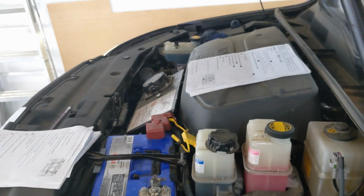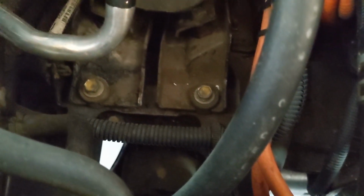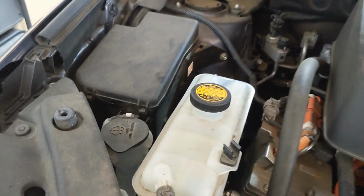Note that the wheels are still off, and I do not hear the pump do any pumping. Another trick I read on the forum is to just start charging the car, and then maybe the pump starts as well. So now it's charging somewhere between 50 and 100% state of charge. But I still do not hear a pump. I heard a relay switch. But that's it.